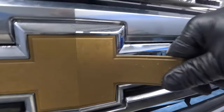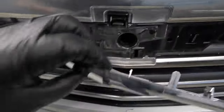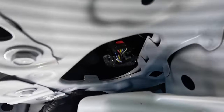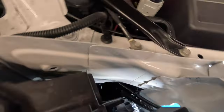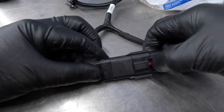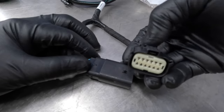Once that's done, pop off the inner portion, then stick a little screwdriver and pry here while pushing from the backside — you can see the lock you're trying to undo right here. Now, this is the left-hand light. Undo this connector: slide this red lock back, then push down on the button. That's going to unlock it from the connector, then just pull on it and it'll pop right off.